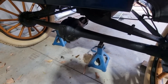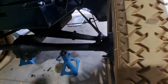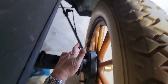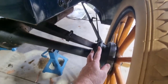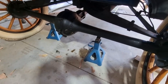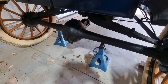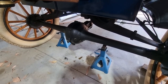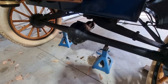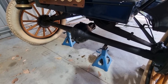So what do I have to do? Wheels have to come off — there's a dedicated puller for those. There's a radius rod with two bolts down here, there's also the spring perch, and there's a bunch of bolts attaching the torque tube to the axle housing — they all have to come off. On the face of it, it's a reasonably simple axle removal, but as these things go, sometimes we can have unforeseen issues.